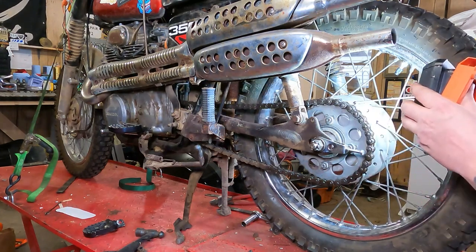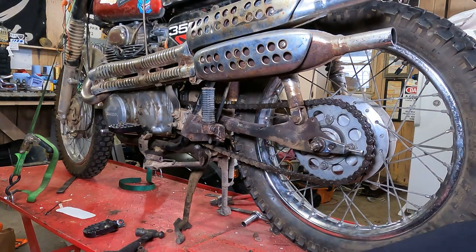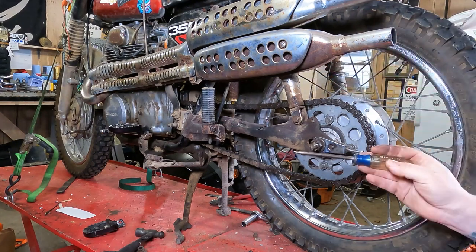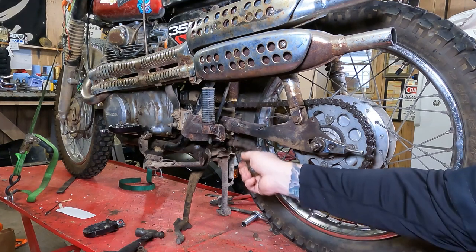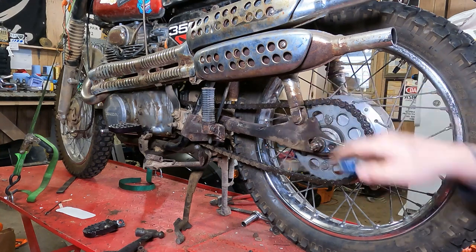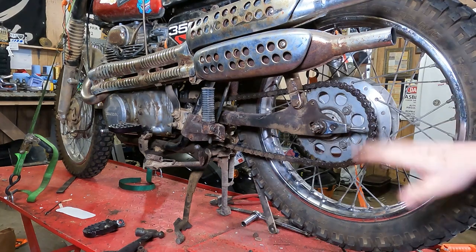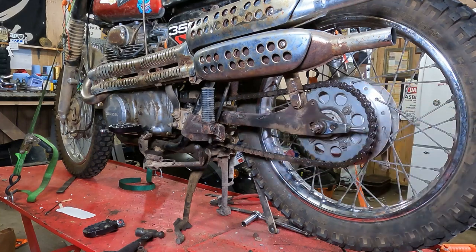Right around there, I got really good chain alignment. With a flashlight I can actually see all the way to the front sprocket — I can see down the top of this chain and see it's all nicely in line, with no weird pitches in it halfway. However, I still have way too much slop right here. I do technically need to compress the suspension a little bit. I have a ratchet strap on the other side compressing the rear suspension enough that everything is pretty much in line.